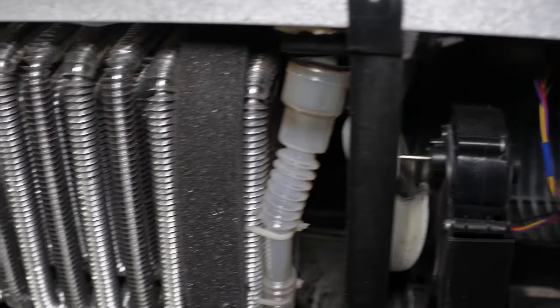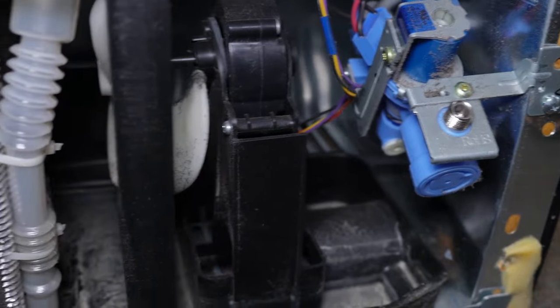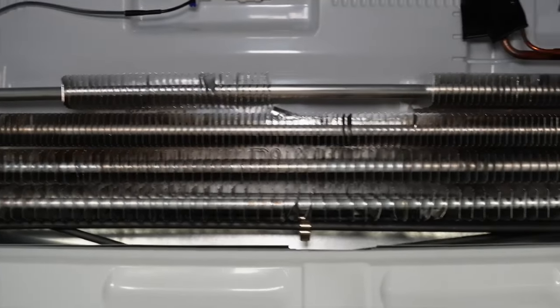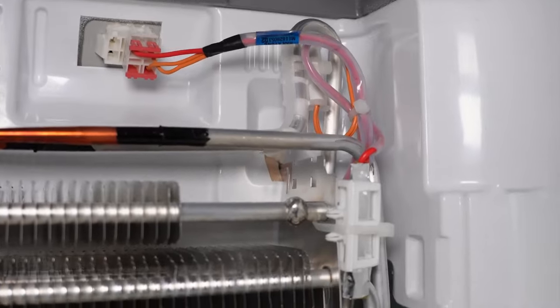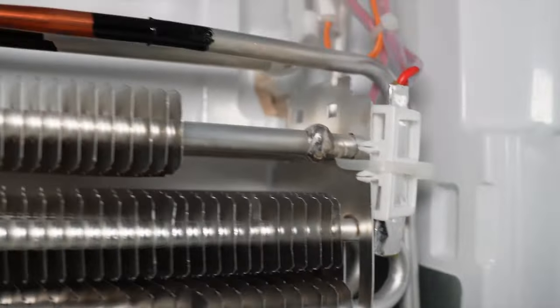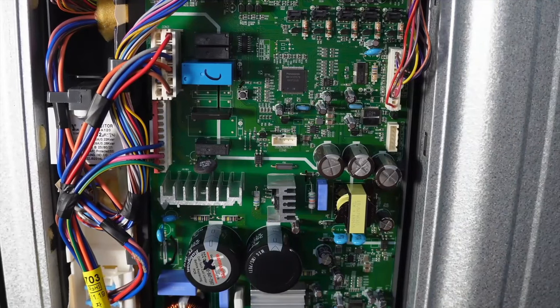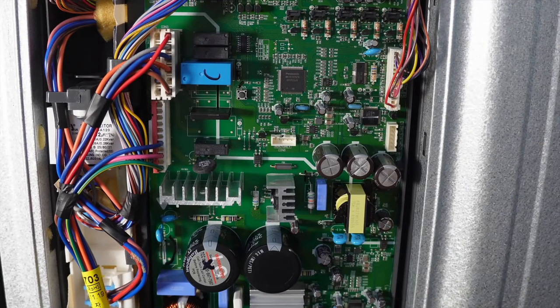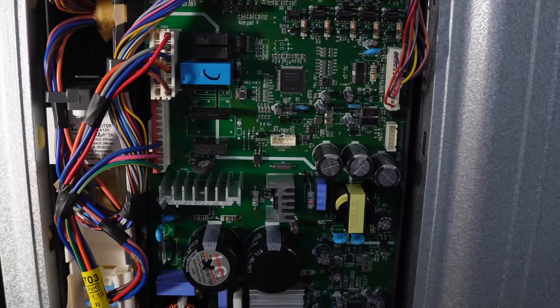On this model, 33 means the compressor should turn off and all fans turn off as well — this puts your refrigerator into forced defrost mode. All systems are off and the unit will heat up. If everything is working properly, you could hear sizzling or crackling noises of the ice melting, and it will remove all ice from the cabinets. This test should last about 15 minutes and will revert to normal. If you want to exit early, press the button one last time — you will not hear any beeps and it will reset the refrigerator to normal running state.